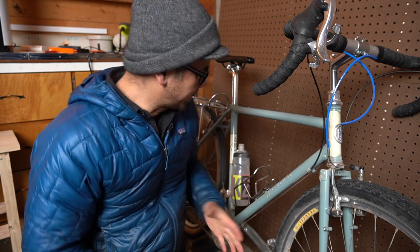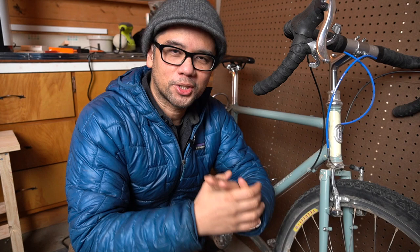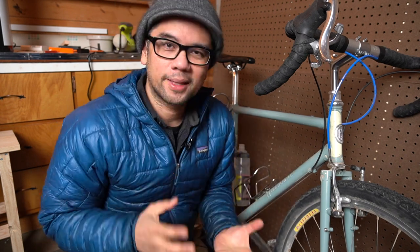In terms of geometry, this is where things get interesting. The rear chainstay on this bike is in the 450s, as opposed to the very short and tucked 425mm on the Crust Bombora. This is most noticeable going downhill — the bike feels super planted, soaks up all the bumps, and it's just a plush riding experience. Interestingly, on the front end the trail number is in the 60s, so more like typical road or road-endurance trail geometry. That makes it actually a slightly quicker steering bike than the Crust Bombora up front. Whereas the Crust likes to hold its line, the Riv allows for quicker corrections — a lighter steering response. The adjectives I use for the Bombora are quick, spicy, and jumpy; for the Riv it's smooth, chill, and supple.